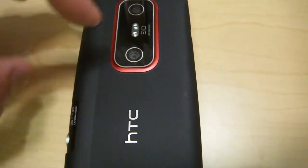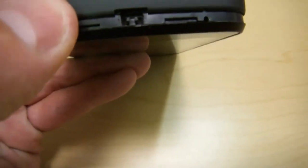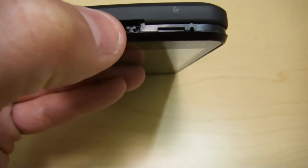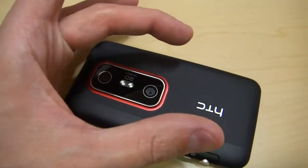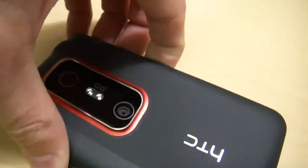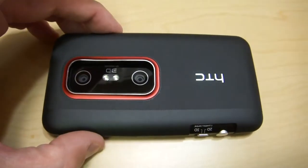There is a proper way and a wrong way to take your case off. I've already taken a small notch in the corner to get started. You want to start at this corner and work your way around, then bring this section off on an angle. You don't have to worry about messing with your buttons — put more pressure on the back side than the front. As you can see, it popped off. You can go either direction, just don't be pulling straight up.